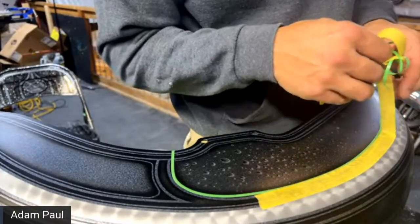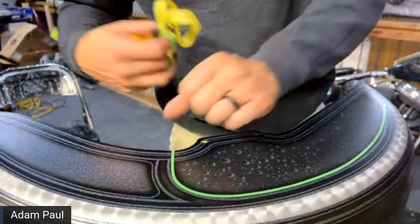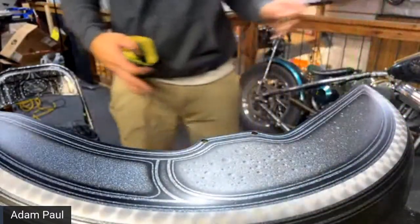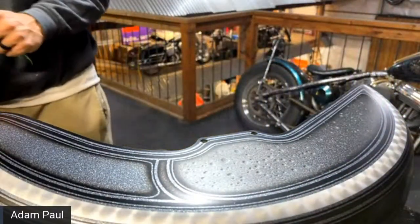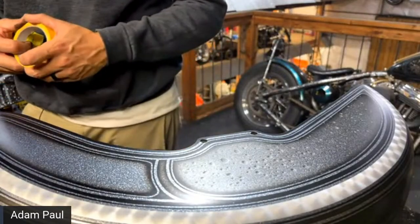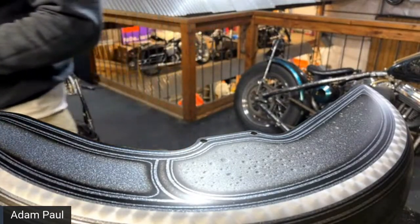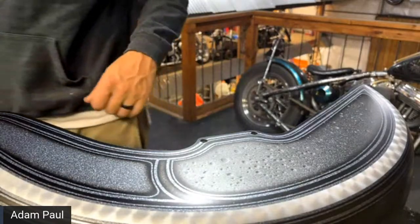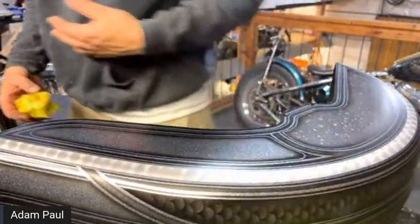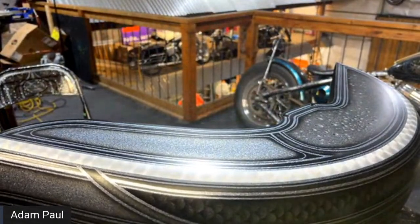And then someone said, how many clear coats when finished? Is there no difference between 3 times and 5 times? There's really not that big of a difference you can tell, visually. You're not going to be able to tell the difference between 3 coats and 5 coats. But it is going to smooth it out better and make it easier to sand and polish it.